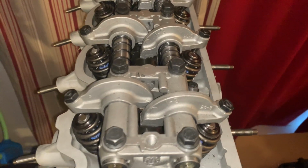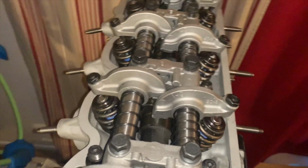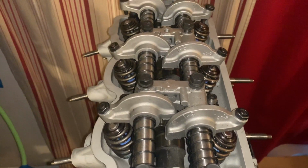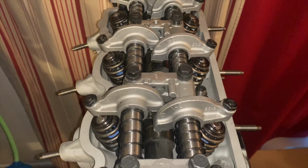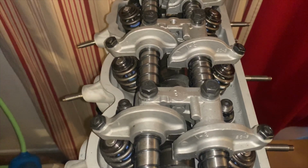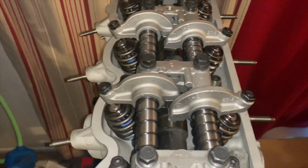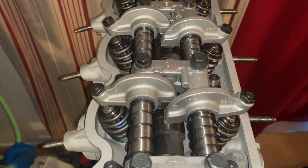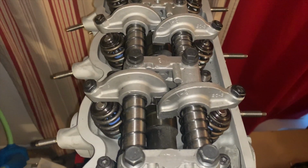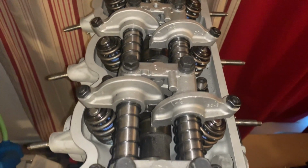So when you are tightening all of these down, you want to do it in the same sequence as you would the head, so it sits down properly. Also, maximum foot-pounds on these, and these are only 15 foot-pounds maximum. Okay, so the manual states from 11 to 15 foot-pounds. So I would find a happy medium and tighten it down from there.